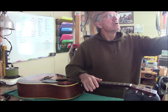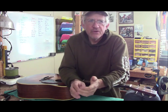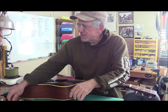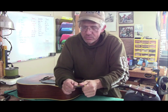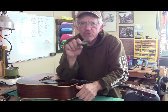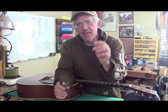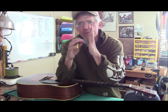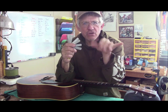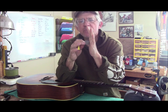Okay? So for instance, when I set the valves on my KX250 dirt bike motorcycle, a 4-stroke, you get your feeler gauge in there and it's super small tolerances. And let's say you go in there and the .003 does not pass, and it really doesn't pass because you're dealing with metal on metal, and it goes thunk and it bumps on there. So you go to a .002, bump, does not pass.